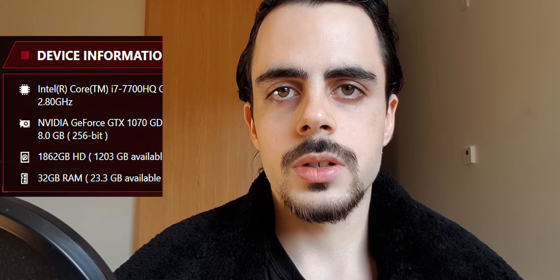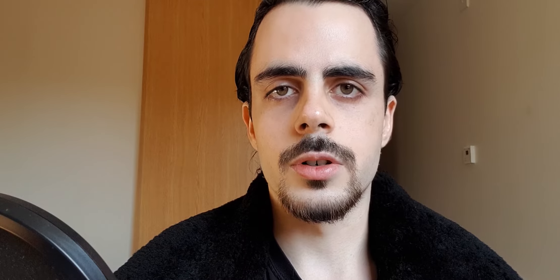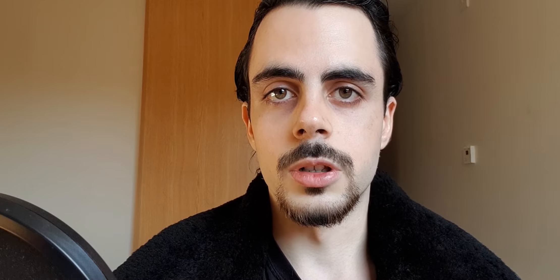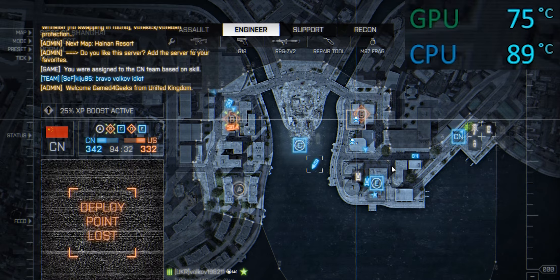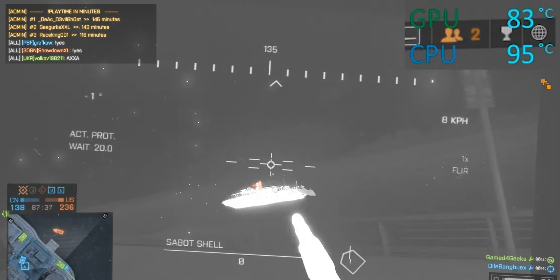The laptop's specs are on the screen right now. As you can see, the specs are quite powerful, yet the laptop itself isn't very thick for a gaming laptop at 23mm. This is very good for travelling but not so good for thermals. The CPU easily reaches 90°C when gaming and is often around 95-96°C. As most of you know, the safe temperature for a CPU is 92°C — beyond that, the CPU starts throttling and its lifespan starts decreasing.